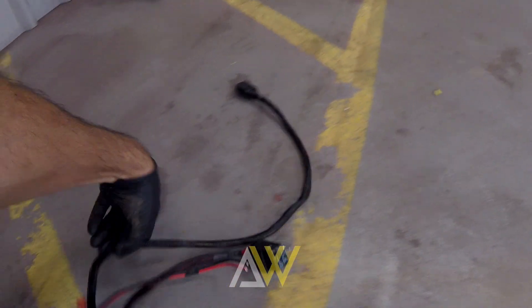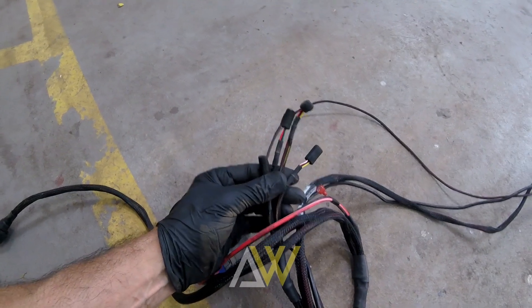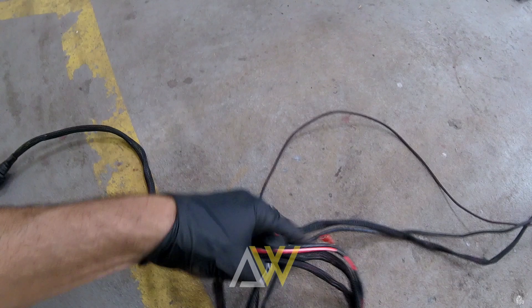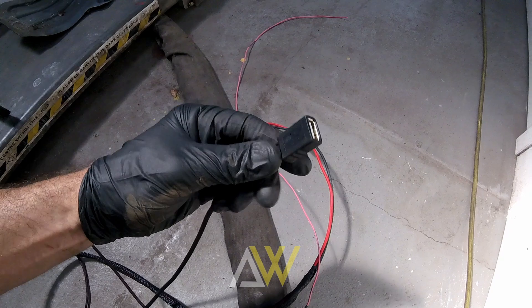This is the loom - that plug fits onto the manifold, you've got a relay, positive and negative that connects to the compressor. These little fittings here: since we are fitting a 3H kit which is the height sensing kit, these little rubber plugs come off and underneath is a plastic connector. This one I believe is for a secondary compressor which we're not fitting, so we're going to blank that off. Then running up to live and negative, the ignition live is the pink wire, and then the USB I think eventually connects to the electrical control or remote on the inside of the vehicle.